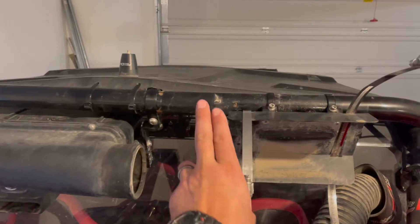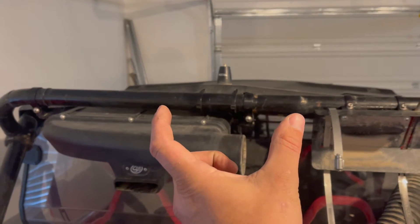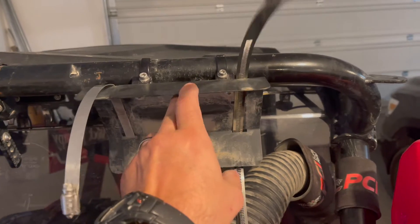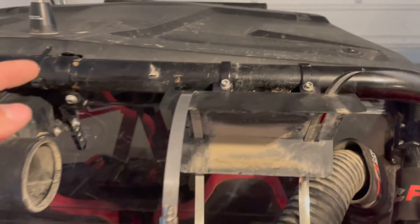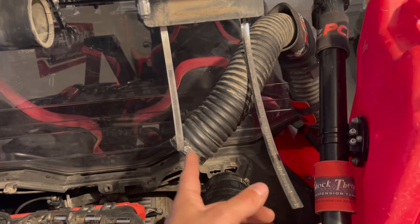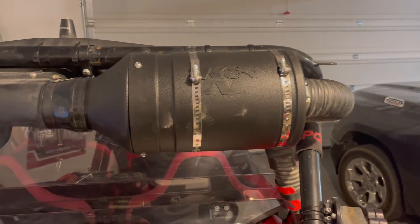What I have going on here is a spare tire mount. I ended up cutting it in the middle, adding a seven inch pipe and welding the end so I could raise it up to approximately the roofline so it doesn't restrict my rear view. I took the Jackson filter housing right there — one new hole plus an existing hole — and I have some Axia Alloys. This pipe up here is one and three quarter inches instead of the standard two inch on the Talon. I positioned both pieces so the housing lines up perfectly and the intake hose goes on the end of the canister.